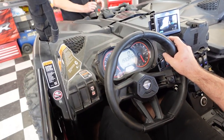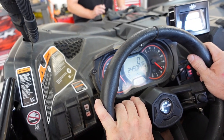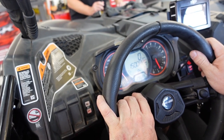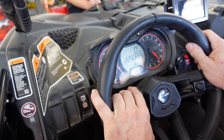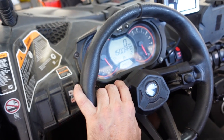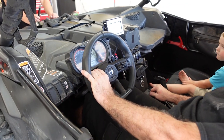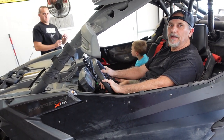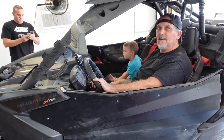So the first thing we noticed is, watch this. We were at a 2100 stall before. Watch yourself because it's going to roll back. We had to hit 23 before. Oh wait, 24.5. It started rolling, it kicked in about 23. Is it a blue spring? What color spring? Orange. Yep, it's there. Alright, let's get to this.